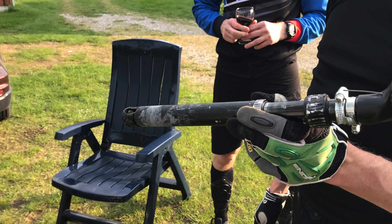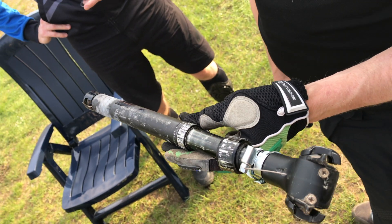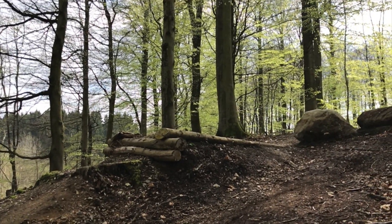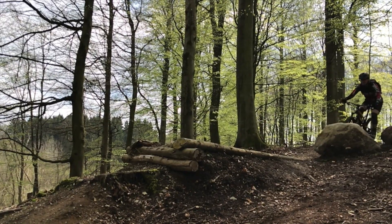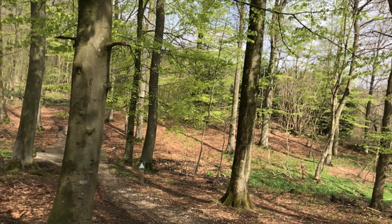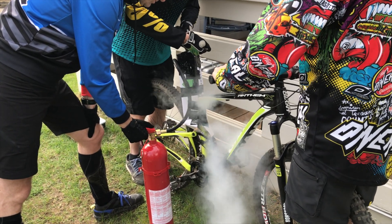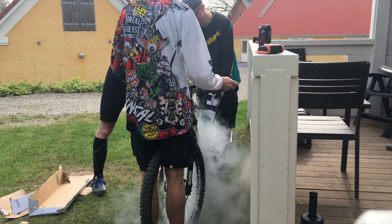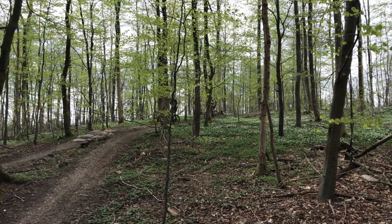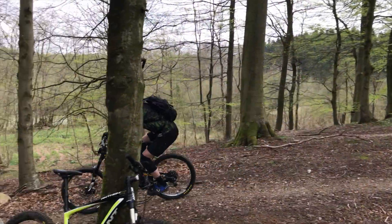What seemed to be the reason it became stuck was that the aluminium had corroded a bit. It's a very tight fit — there's not even a millimeter of space — so the least amount of expansion would probably seize up the dropper post or any seat post. In the future I'll take it out every month and apply some carbon paste to make sure it won't get stuck again.